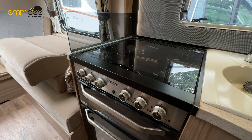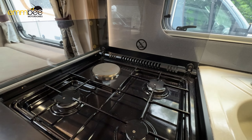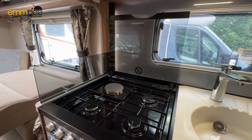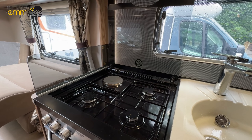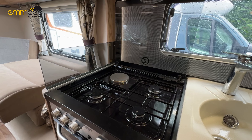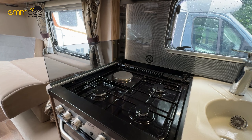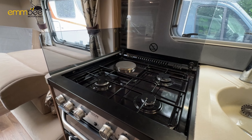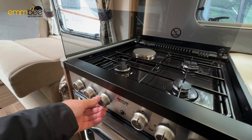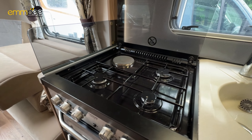Next we've got your kitchen sink. You want to prime your system once you get to your destination or site. Once you have filled your fresh water tank, turn your pump on and then open the tap onto cold — that will eventually bring the cold water through. Then twist to the right and bring your hot water through; this might take a minute or so. The reason for this is it will fill your boiler up first and then eventually come through your tap. At the same time you are priming your kitchen tap, you may as well do the shower and basin tap so your water system is fully primed and ready to use.